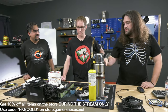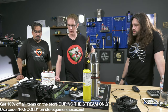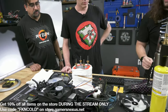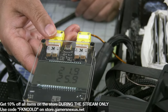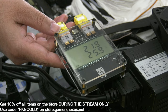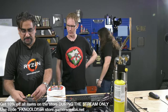For temperature monitoring we have thermocouples - one in the container itself in a hole less than a millimeter from the top of the CPU lid, and another one wedged in monitoring the inner memory stick to make sure the RAM doesn't get too cold. I want to keep the memory as close to room temperature as possible, since DDR5 can be sensitive to temperature swings during operation. This thermocouple reader from Elmore is built really nicely, with two inputs. The new version has a backlight and takes one battery.